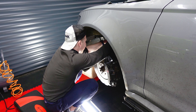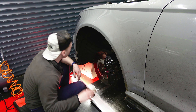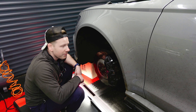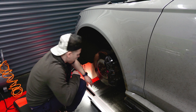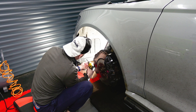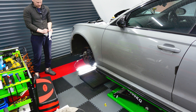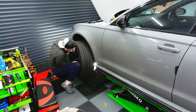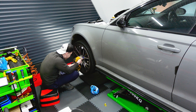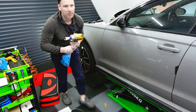Wheel arch linings. Don't forget, first of all, to reconnect your washer bottle and your wipers, otherwise you'll have to take everything back off again - that's just a push fit. When you're putting this guard back on, don't forget to reconnect the condensation pipe off your headlights - there are a couple of clips that just clip on. Now I've got about 20 T25 Torx screws to send all the way around this arch lining.